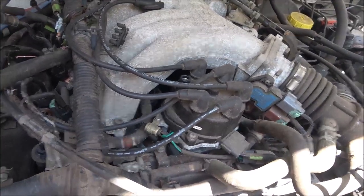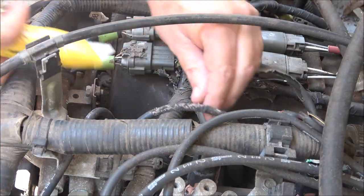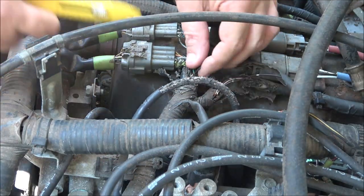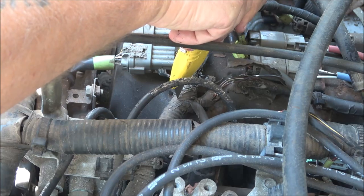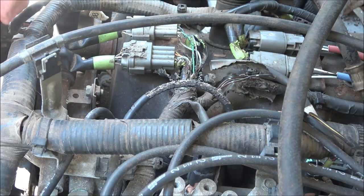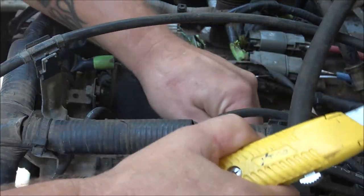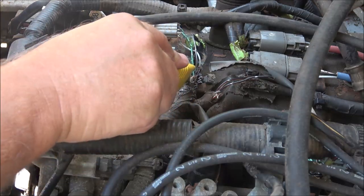The first thing I'm going to do is try to get this cut back. There's a plug wire right here that's chewed up anyway. We're just going to cut this back, try not to cut any more wires. May have to unplug and find out the firing order — not real hard on this thing. Firing order is 1, 2, 3, 4, 5, 6. It's a 3.3 liter and it goes counterclockwise, so that's pretty simple.